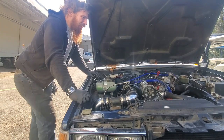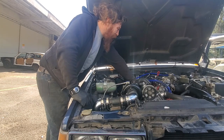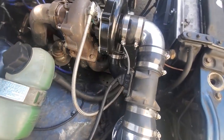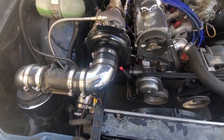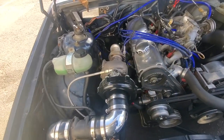I call this our Stage 3 B23, and we've also done a manual conversion on this car. What we've done here: we took the original head, had stainless valves put in it. It's got a KL Racing Stage 3 Turbo Cam, 3-millimeter lash caps. There are some other goodies getting put on this engine that aren't here yet. We've got an adjustable cam coming. We have an STS machining electric fan, which is what we're going to be using on the Shifting Lanes car.